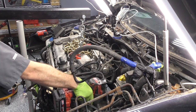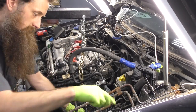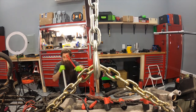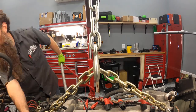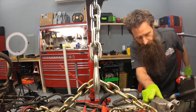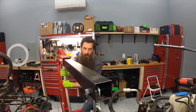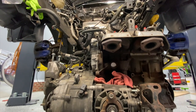It is time. We are down to four bolts left to get the engine and transmission assembly out of the car — two bolts for the engine mount and two bolts for the transmission mount. I'm going to lower the car down, take a floor jack up underneath the transmission, lift up on it a little bit, unbolt the mount, and drop the transmission down some. Then I'm going to take one of those bolts from the transmission mount, hook my chain to there, hook my chain to the other side on the engine where there's an eyelet you're supposed to hook your engine hoist up to. Bring the engine up a little bit to fully support it with the weight of the chain, then unbolt the engine on the passenger side. We've got the engine, transmission, and bevel box down on the ground on one of these little rolling platforms, which makes life quite a bit easier. All in all, not a horrible job.